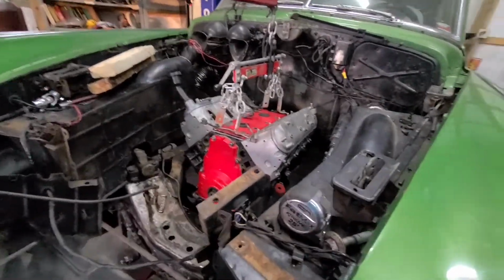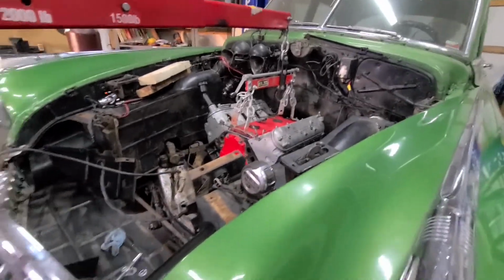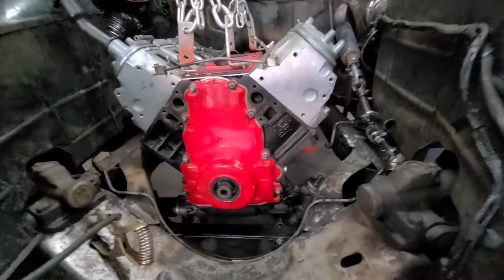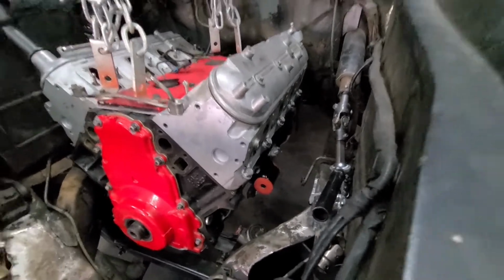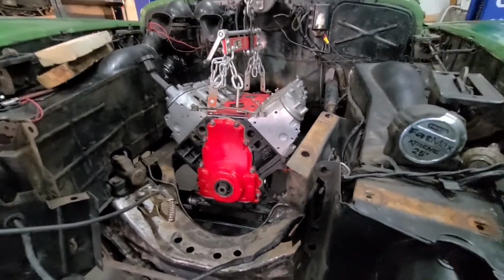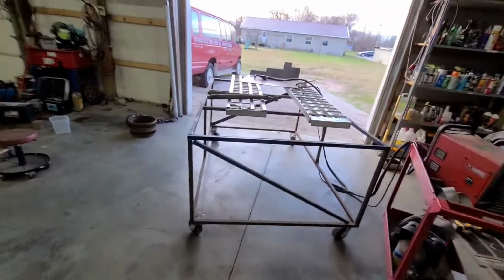Okay, we're jumping all around on this project. The rear end is kind of mounted. We got the motor sitting in there where it's going to go. We've got that side welded in or tacked in. We're cutting out new pieces to mount this side. We've got these universal bushings on here. Because of clearance with the steering rack, we had to move it slightly to the passenger side so the factory mounts aren't long enough. So we got the plasma cutter set up over here again,